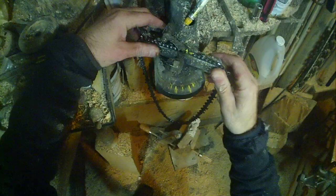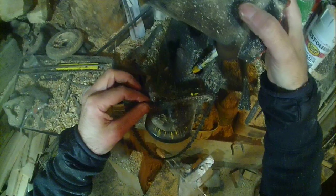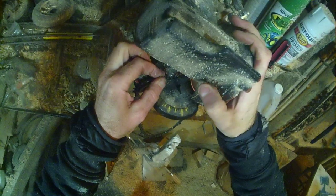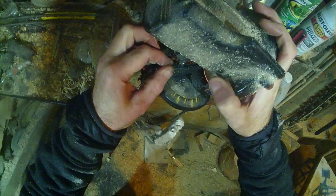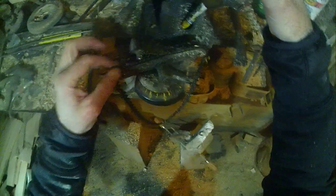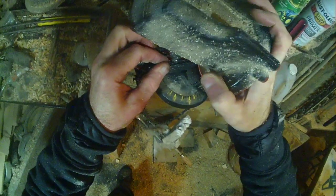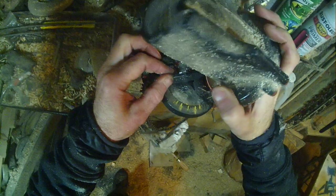The chain doesn't get sharp by the grinder alone. Like I mentioned before, you can run a scuff chain, a chain that's just scuffed on the grinder, just fine. It's all really personal preference. Sometimes a scuff chain is a faster chain. Sometimes it's the worst chain to have. But it really depends on what you're doing and how often you need to sharpen.